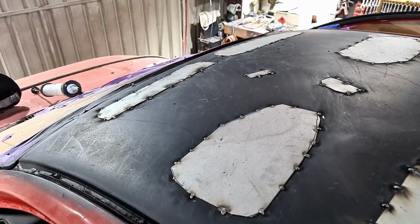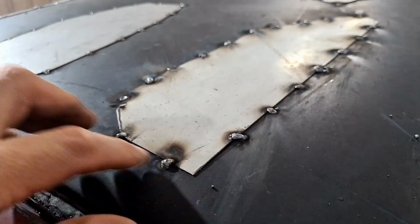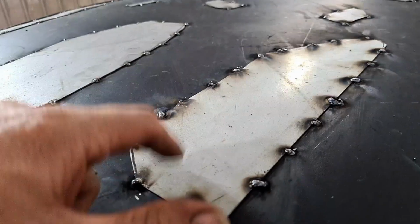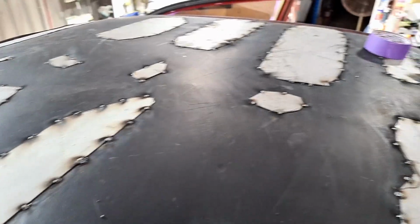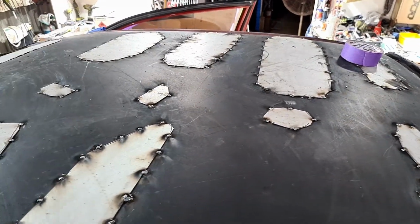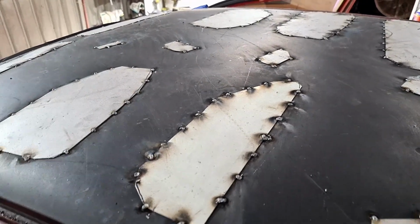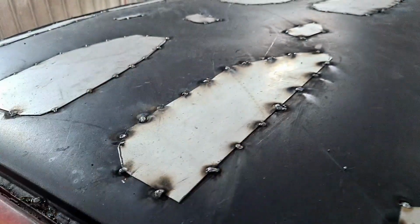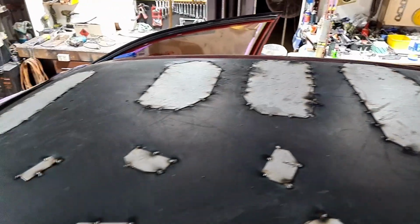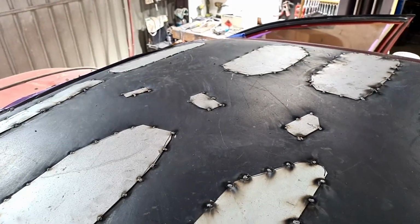So now I'll just grab the flappy disc and take off the height of those little tacks, so they're flat with this sheet. I'll take that off and then, I'm winging this as I go. I don't really know what I'm doing, so I'm either going to use that polyurethane and smear around all the corners so it's a smooth edge, and then I can paint it that black etch again, and then it's ready for an actual undercoat. So it's as sealed as it's going to be, hopefully.